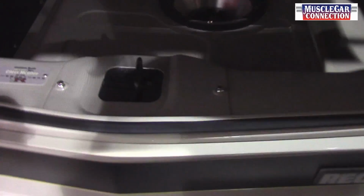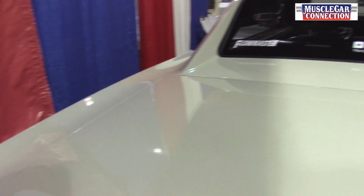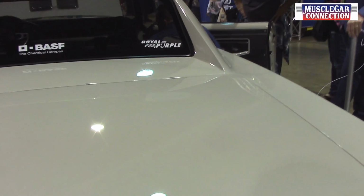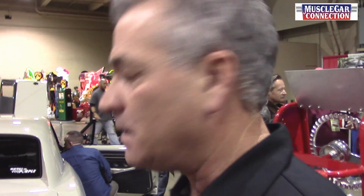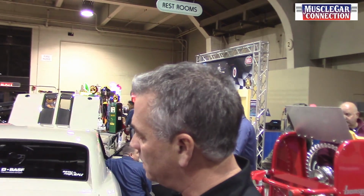And we use an old Cadillac latch because it really sucks it down and works pretty slick. You can see it pulls it down. The reason we have to do that is because the gaps are so tight. If you slam the trunk, it would actually have chipped the trunk plate or the edge.